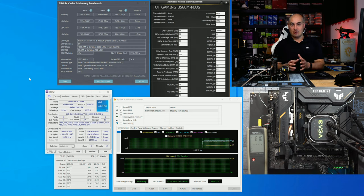It's not ideal to run an i9 with a board like this because you miss cache overclocking and a lot of performance. This specific CPU — or even the non-K version — will be fine with this motherboard for a balanced build. If you want performance, you'd go with a Z590 anyway. The VRM seems to be holding fine.